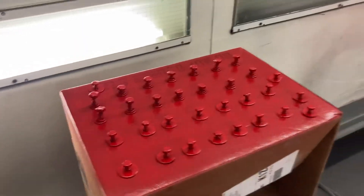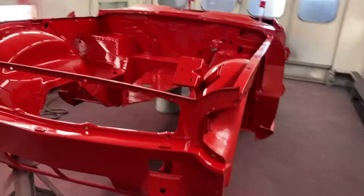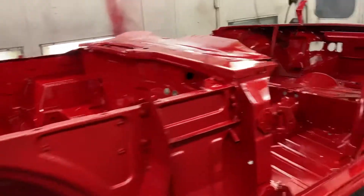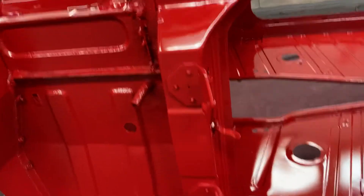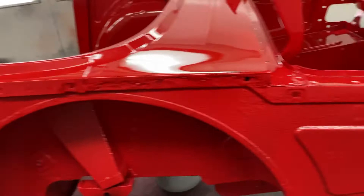I painted some of the bolts for the front fenders and stuff because I don't want to open the hood to paint inside — I'm going to paint it with the hood and the trunk lid closed. The doors all open up and I'll respray some of it there. I just jammed all inside the doors anyway, just so I don't have any overspray. It's easier to sand the paint than overspray.